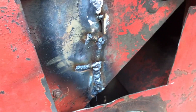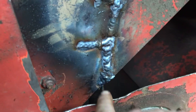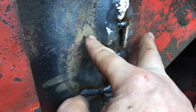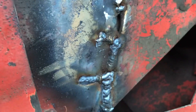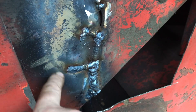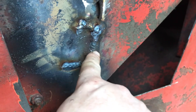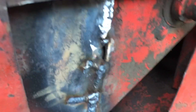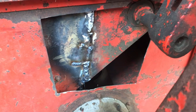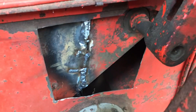That's how it looks so far — I'm not the prettiest welder but it is welded and it is closing up the gap. We started at the bottom, welded that, took the weight off it, tried to make the two sides collapse back into each other, spot welded them, and then slowly closed up the seam all the way up. It's all hit and tinted so it's not going to be perfect. We've welded this section up here and up there, now seam welding all the way up — afterwards it's going to be plated on anyway so you won't see any of that. This is probably the easiest way; otherwise we'd have to take the whole unit out the back of the combine and that's a massive job.